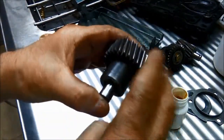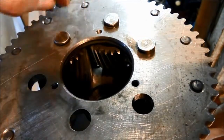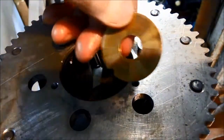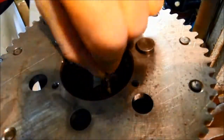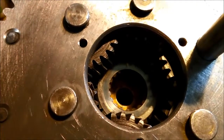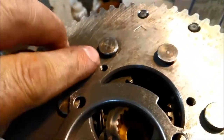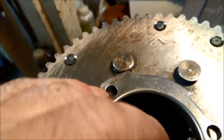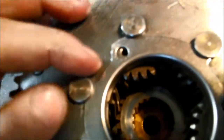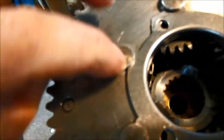That looks good. When putting these back together, try and align that slot so you can put it in easier afterwards, and don't forget to put your new thrust washer in there. Don't forget the sun gear, and just knock this last pin in and we can put the plate back on. If the plate won't go back on easily, get a little punch that'll fit inside that slot and knock it around a little bit until it does. We did this one pretty good - it's almost in line with the hole. We'll tap that with the punch until we get it down, then knock those pins right down so they're just touching that plate.